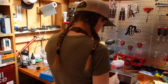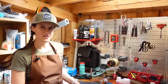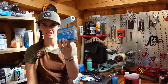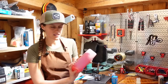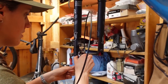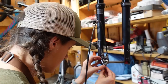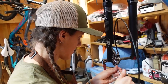Would you like to do the front or the rear brake first? We do whichever one's on top. For this task you will need your new brakes, oil funnel kit, disc brake hose cut tool, brake cutting tool, paint pen, eight millimeter crescent wrench, pokey tool, and Shimano hydraulic mineral oil. This is where you think it goes like that. At this stage you don't really worry about centering your brakes — you can do that later. It feels kind of tight because there's Loctite on there.